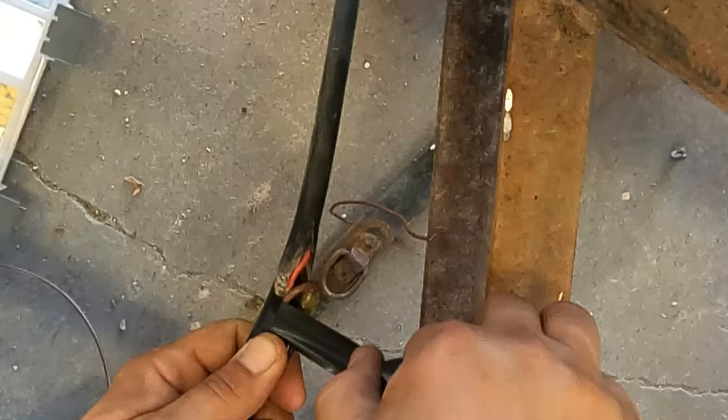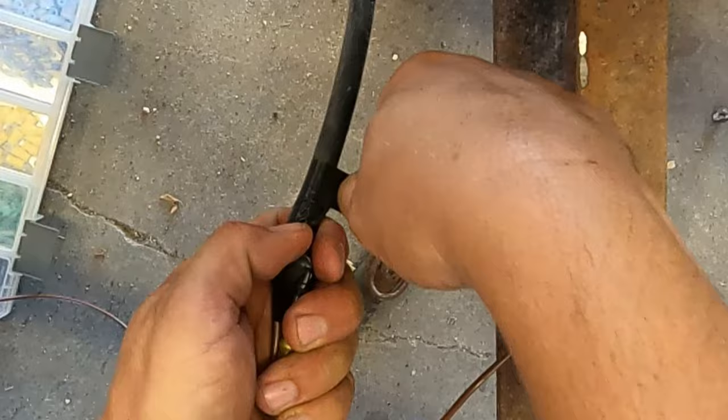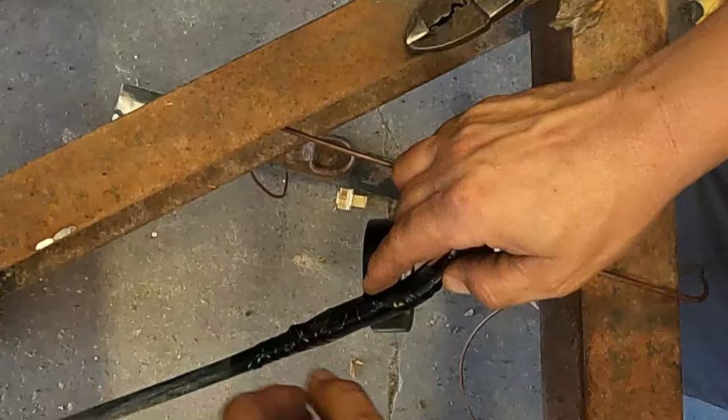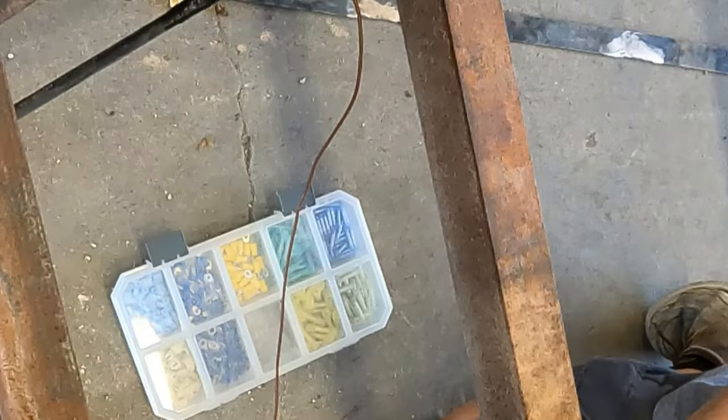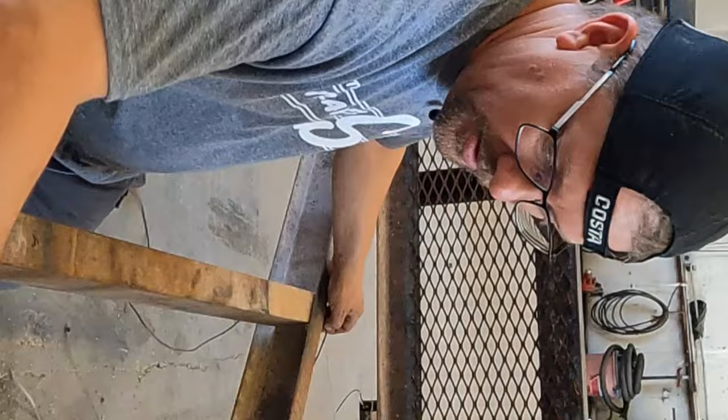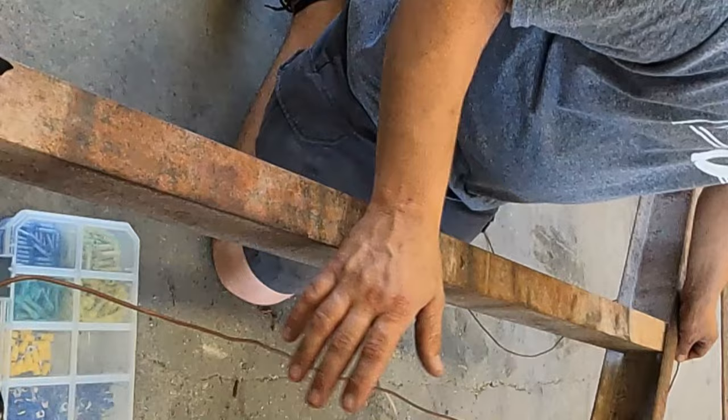This connection, since it has a heat shrink, really doesn't need electrical tape, but we're going to do it just because the insulation has been split. The way this wire is run from the factory, it just hangs across here like that — so it's going to hang down. You have the option of welding on some conduit or something like that. What we're going to do, once we have the floor in, is use some clamps that will actually attach to the underside of the floor to hold it up so it's not hanging down. We'll clamp this connection up to the underside of the floor with a good rubber-coated clamp to make it nice and clean.